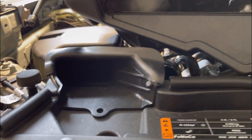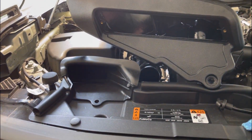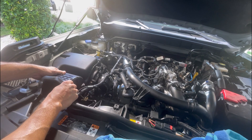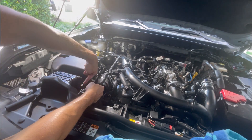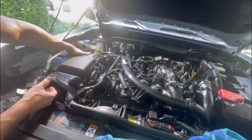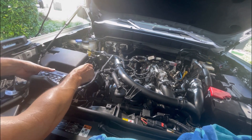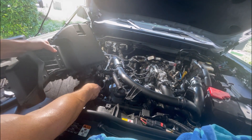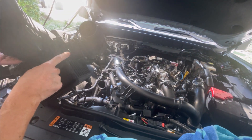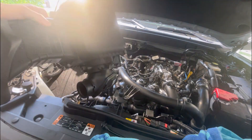This is your stock air box — look at the size difference between the Eventuri and the stock. We're going to pull out this whole air box. Make sure your wires are out of the way; there's one down here that you're going to want to pop out and disconnect. Just reach underneath, lift up, and you'll feel it pop — then you can pull this whole housing. Make sure you remove the one that was attached here, and then we can pull this out.